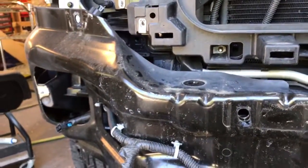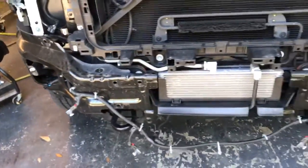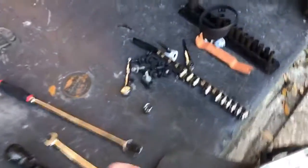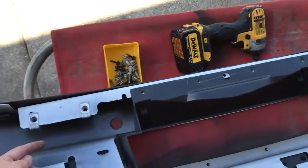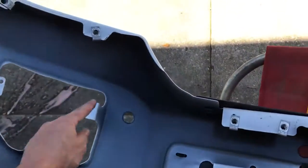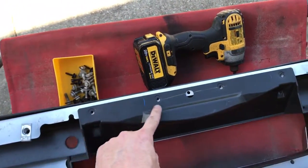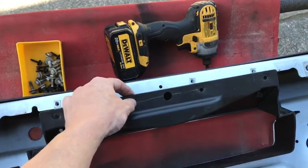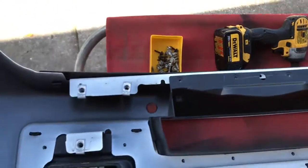I actually have another video that shows a little bit differently how to get this bumper off, so just look through my channel and find the other video — it shows how to get it off. This piece right here on the back side is the top of the bumper. All the sensors are in here and that wire runs across and behind this. Take a 7mm and there's one, two, three bolts here and then this comes out. There's a couple little things that stick in there to hold it on — you just pull those out and then you'll be able to get that whole harness off, and then this whole bumper will come right off.